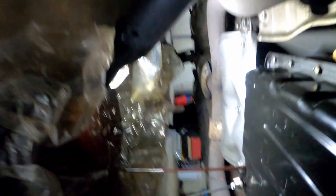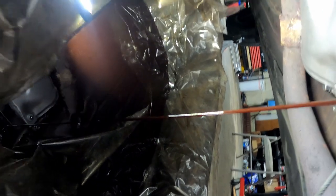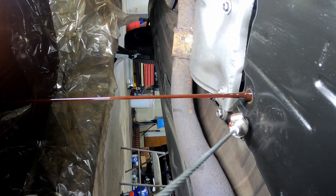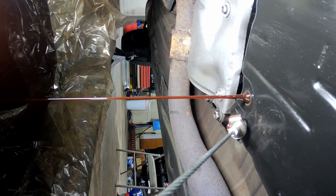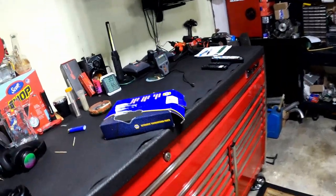When you check your fluids, transmission fluid should be one of them. Transmission fluid should be red. We're doing a drain and fill — we're not taking all the fluid out of the torque converter and all that. We're just doing filter and fluid. It's going to drain out around three and a half to four quarts. I'm going to let that drain some more, then come back and get these 10mm bolts all the way around and get that pan off.